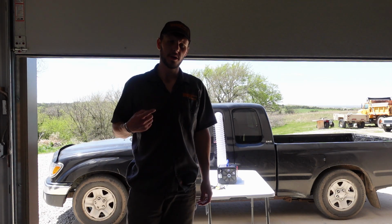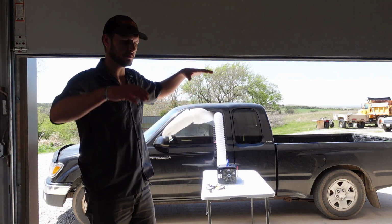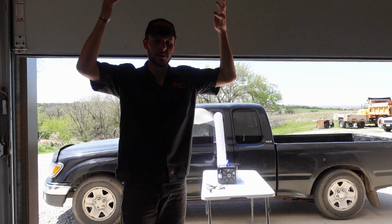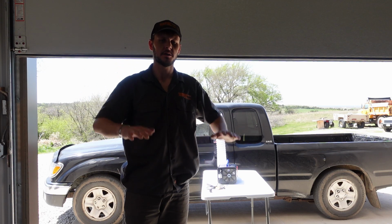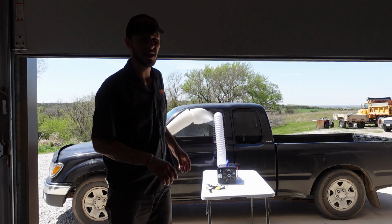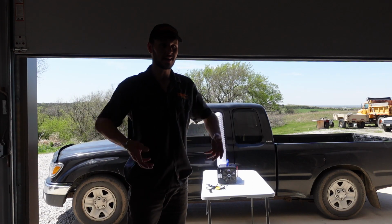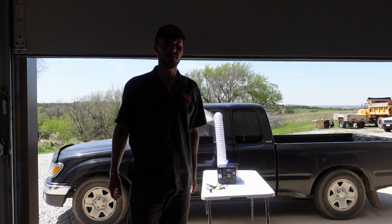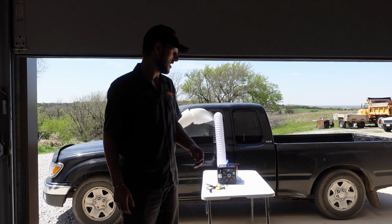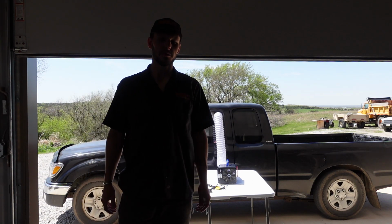And so one other thing you want to know is you want to have that ozone come in as high as possible so that it settles down from the top down, because it's not going to naturally go up, it's going to come down. So by putting that tube going in the window at the top, that's perfect. For people that set them on their center consoles, they're not getting that upper half really necessarily filled unless the air vents have ozone left in them and they're blowing it up. So having that coming in, it's shooting across the whole cab. That should work really, really well.